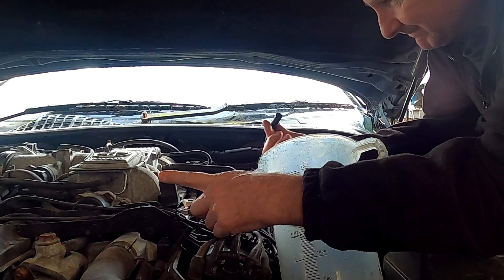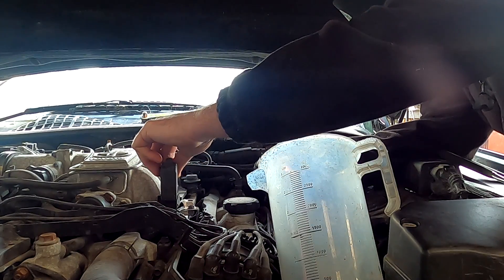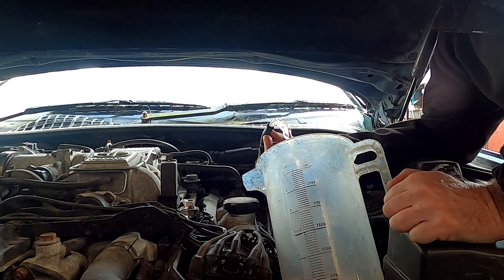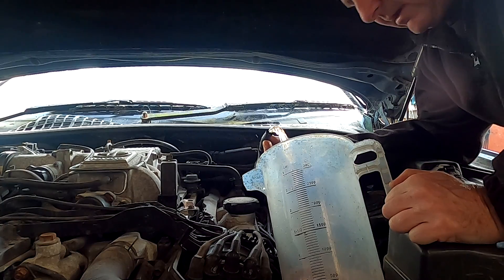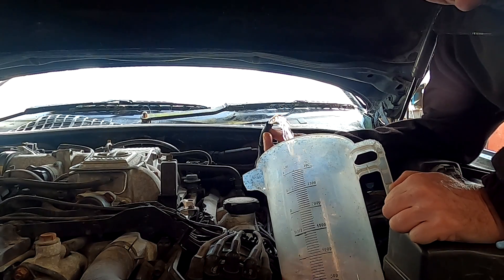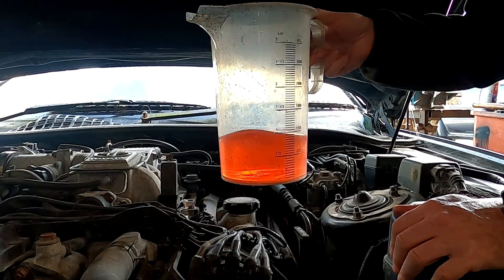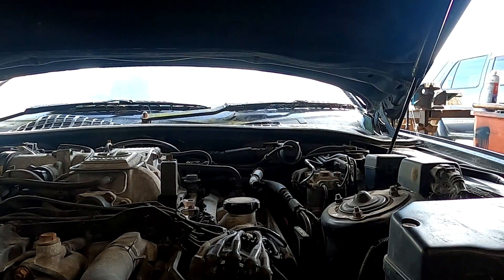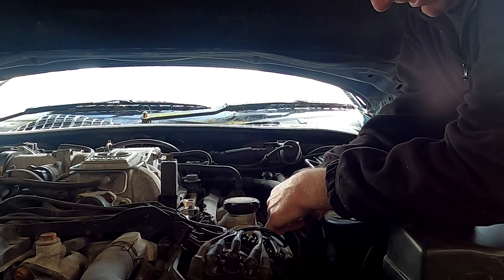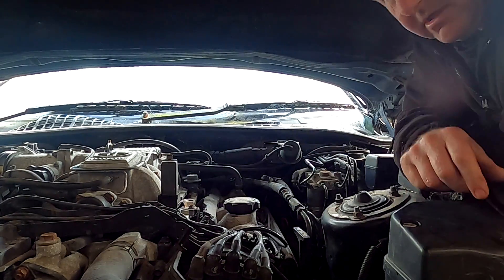I've got my container, I've got my return line off, and I'm just going to bridge the diagnostic box and look at that fuel flow. I would time that, and in 30 seconds I would want to get a litre of fuel. That would give us 120 litres an hour, and that is the minimum that I want. I can see that's plenty - that's doing what we want. So in that time I got a litre, it wasn't even 30 seconds. It's flowing plenty, and I know the engine runs well now. A fuel flow check like this is a really good place to start.